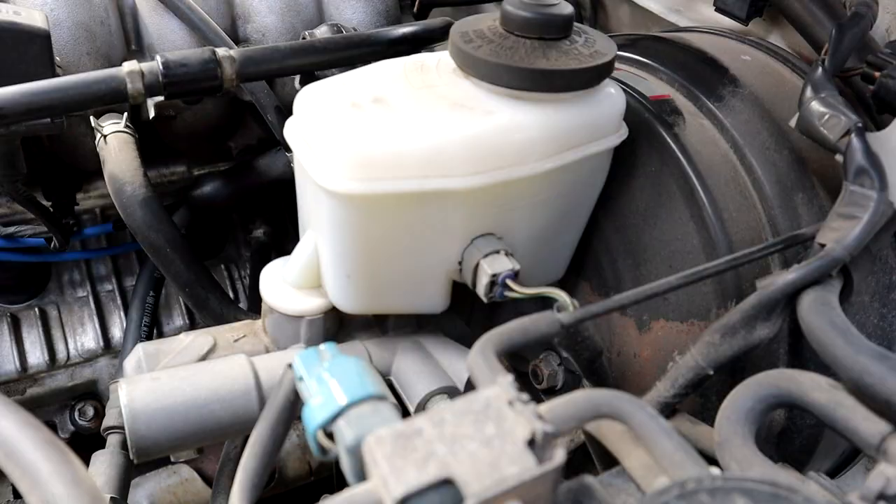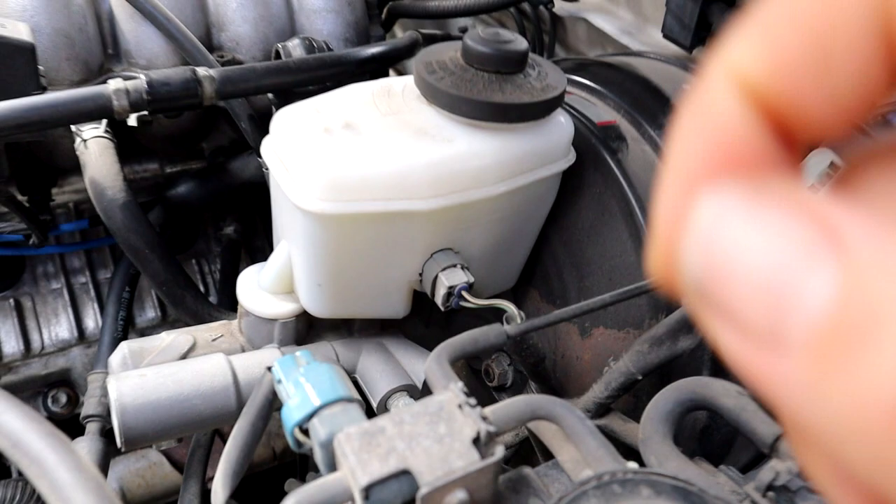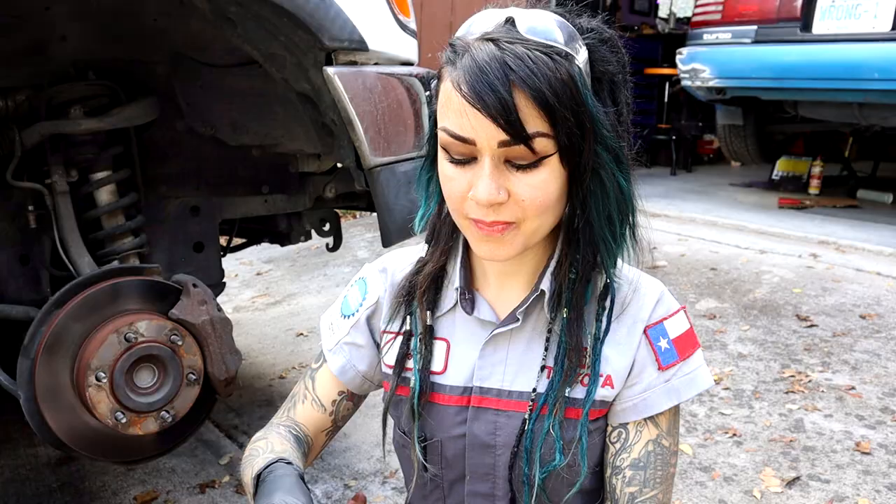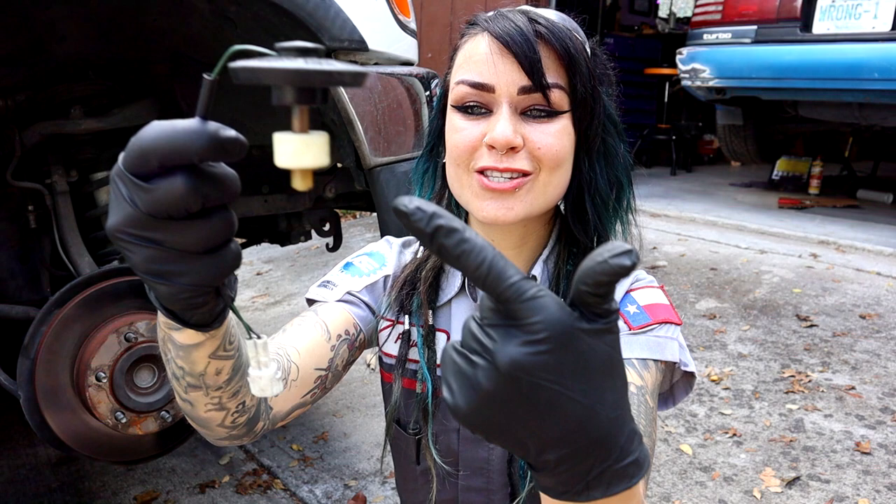For example, on my lovely 1998 Toyota 4Runner — built into the actual reservoir on Grim Repo here, you can see the brake fluid level sensor. You can find a similar design on older Toyotas too, like my 1989 Toyota Supra. Built into the brake fluid reservoir cap is this switch which will turn on the brake light when the fluid in the reservoir goes too low.